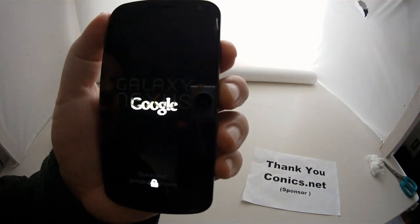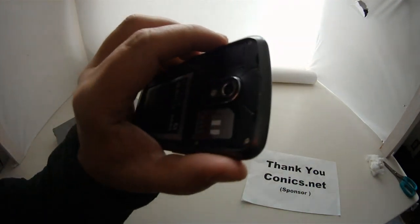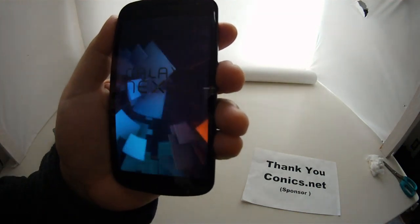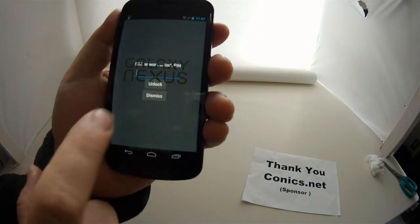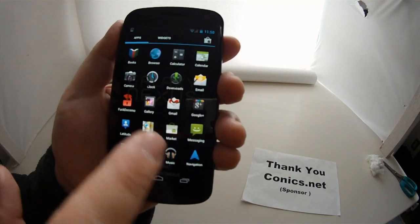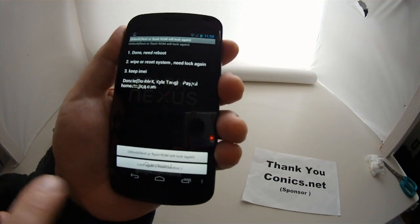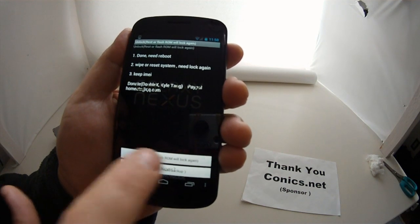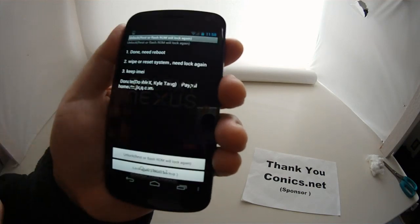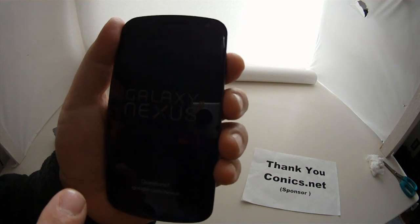Once we restart, we're going to run the FACTOCOMO app one more time, but this time we're going to do a temporary unlock. The temporary unlock will unlock the phone again. I'm running a SoftBank SIM card, so the lock screen will show up again when it restarts. Just dismiss the lock — it says locked, enter the code, but we don't have the code so just dismiss it. Then run the FACTOCOMO app again, but this time hit Unlock — not Unlock Forever, just Unlock. It says unlock, flash ROM will lock again. Hit Unlock, it does it, and then we have to reboot. When I reboot, you'll notice the phone will be locked again.